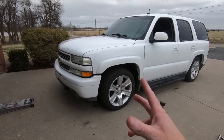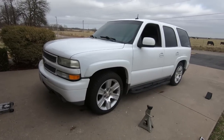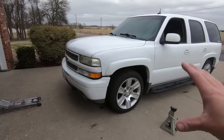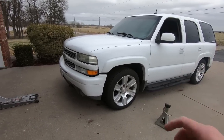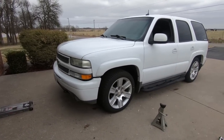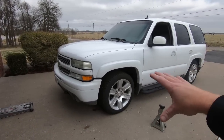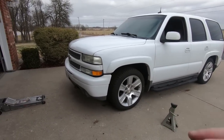We're going to loosen those bolts that we ran all the way tight, and like I said, this is going to be kind of a trial and error. Then I'm going to drive it up the road and make sure it settles out, and then we'll test it again. So don't think that this is going to be a just install and done. This is something that you're going to have to tweak, and after I actually get it where I want it, I think I'll probably drive it a couple miles up and down the road just to make sure that it's not slammed right before I get it aligned. So obviously we got to get an alignment after this, but basically I'll show you guys once I get back from the next drive, and if it takes another one and so on, but we're getting close.